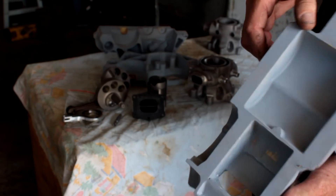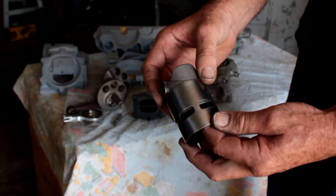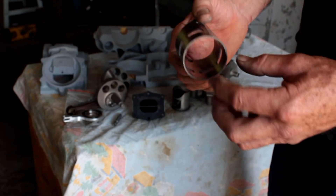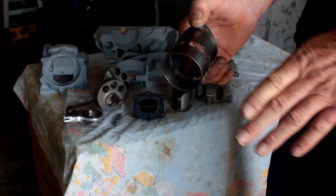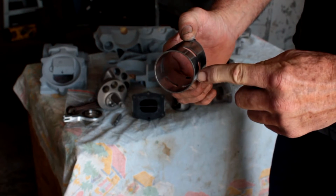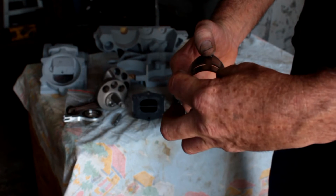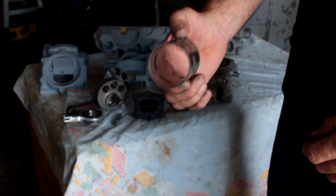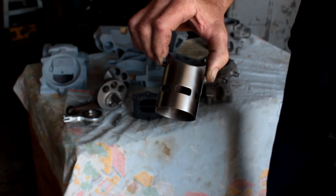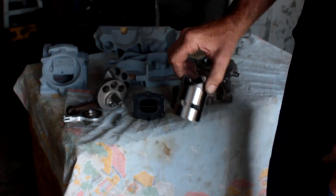That's the sleeve - it's 4140, it's been nitrided. That's not actually the piston but it does fit. Just like the Rolls-Royce Crecy back in the war era, what they call - there's no piston ring sealing. It just relies on the top edge of the sleeve to expand with heat and seal against the outside of the aluminium barrel. So technically the sleeve and the barrel grow and shrink together with thermal loading. Even I find it hard to believe it's not going to seize, but they got thousands of hours and lots of horsepower on a similar system, and it worked - so why can't we have a go.